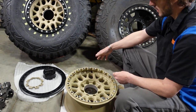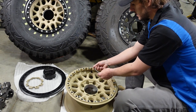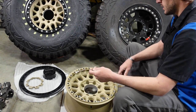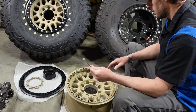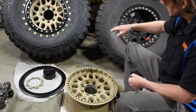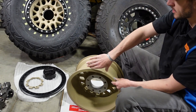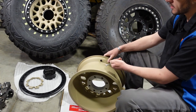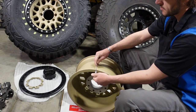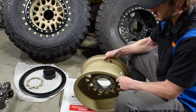When I was installing one of these, I put a tire on and forgot to put the valve stems on, so I used that tool and snaked it through. I'm thinking if I'm on the trail and I cut a valve stem, going the rubber route, this would save me a lot of time — because with bolt-in ones, you're taking the whole tire back off. You could possibly go to a tire shop, break the bead off the backside, snake the tool all the way through, and install the rubber valve stem from there. That's the major perk of the rubber valve stems.